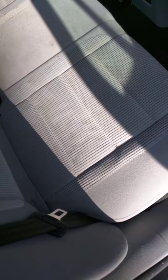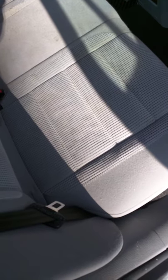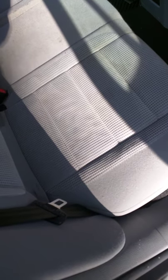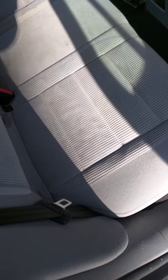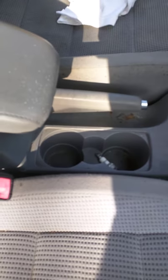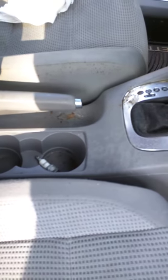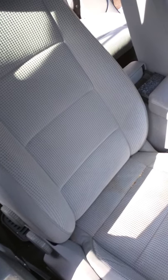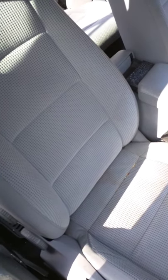I'm going to need to start up the car, maybe turn the vents on, put it on recirculate, and let the ozone kill — because ozone kills anything living. You don't want to inhale this. When you turn the machine on, find a way to rig it up. Most of them have timers. Do not inhale that stuff — the ozone — because it could damage your lungs. Once you finish with the ozone generator, you want to air the car out. Open up all the windows and let the car air out.